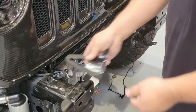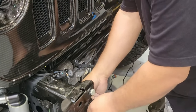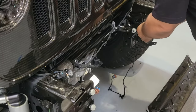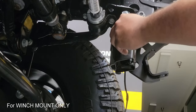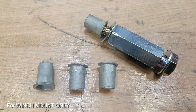Now we're going to reinstall those factory tow hook support brackets on the inside of the frame rails only. The reason we're going only snug is that we're going to have to use this to hold a bracket in position — it'll be removed later in another step to make sure the final assembly is done in the correct order. Now the next steps are optional, for if you're going to do the installation on the winch mount, which you will see me do. This requires installing a few rivnuts into specific holes depending upon the bumper configuration you have.